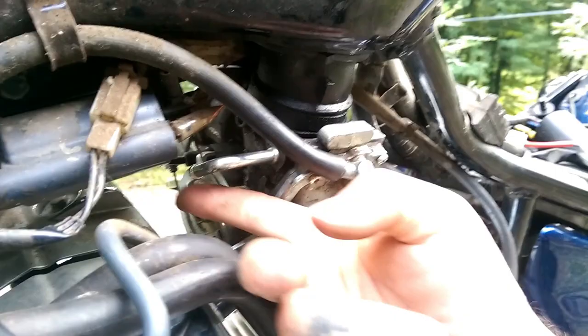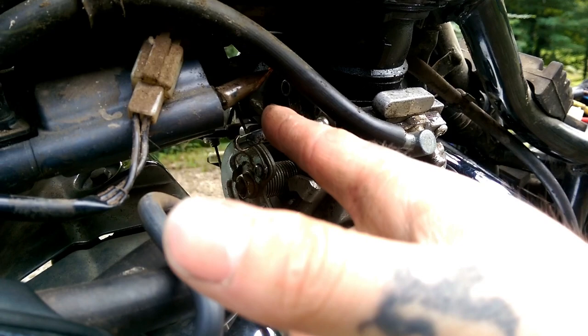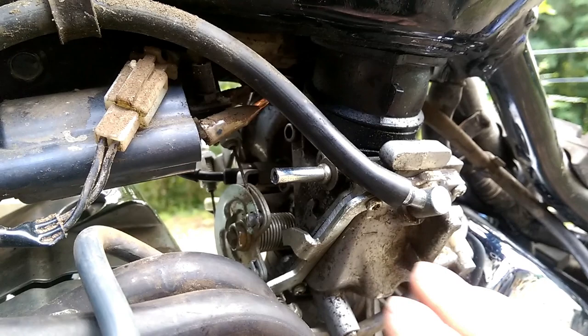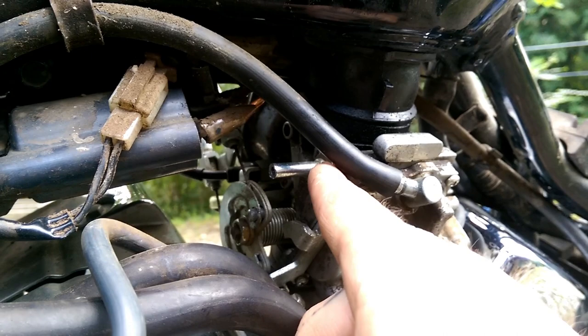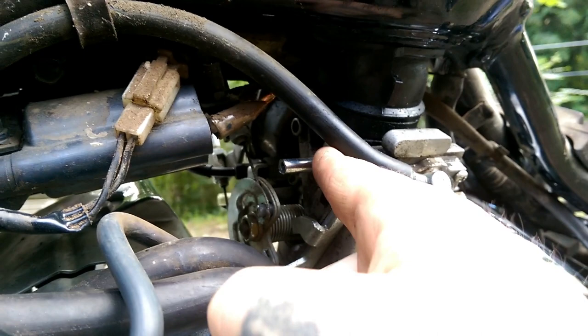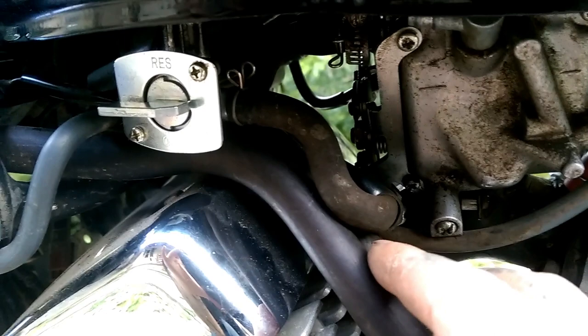Before installing the tank, this petcock spout is bent — if you run it as-is, it comes straight out and you're going to have to wrap the hoses all the way around, which isn't going to work. What I recommend is just taking a hacksaw and sawing it straight. Now that I've got mine cut straight, we should be able to hook the hoses on pretty easily. You do not want to try to bend this because it can cause a leak. I don't recommend that — just take a handsaw and saw it off.